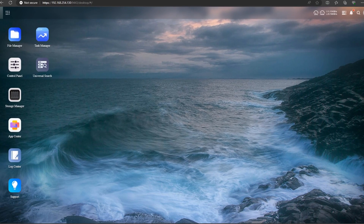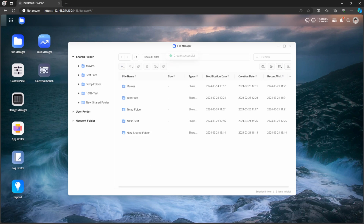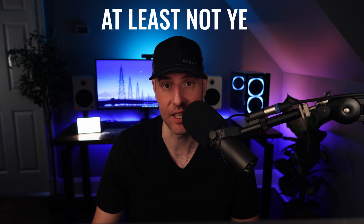The Ugreen OS is designed to be a NAS first. You can configure a storage pool and volume, create shared folders, access those shared folders using SMB, NFS, and more, and basically just have a functional NAS device. They have a few applications, but quite frankly they are extremely basic and immature at this point, and that shouldn't bother you because you're not going to buy this device for any of those applications, especially through a Kickstarter.